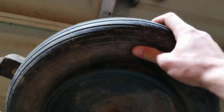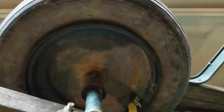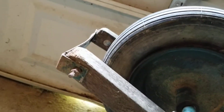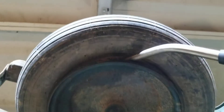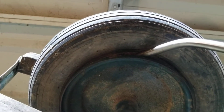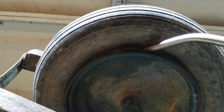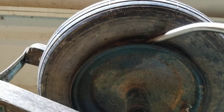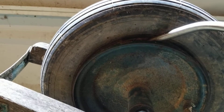So what I'm going to do now is put a little bit of propane into this unseated tire, just like this. You just stick it in past the bead and let some propane go in. Now, propane is heavier than air, so I will turn the tire around just a little bit once I get all the propane in there that I want.